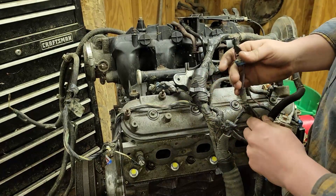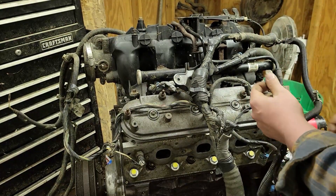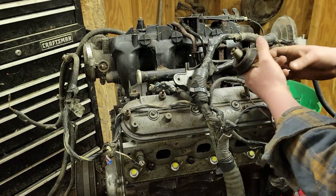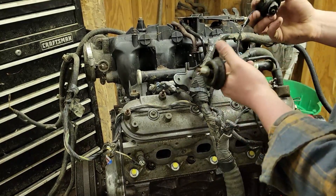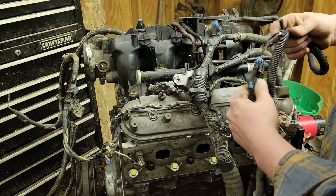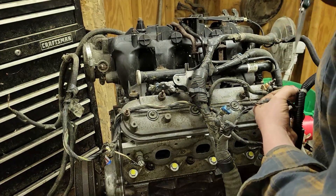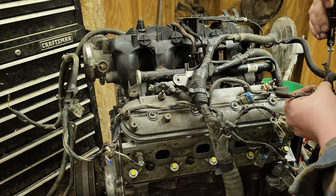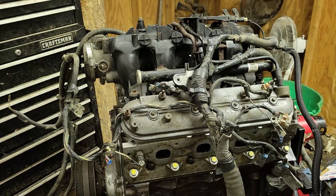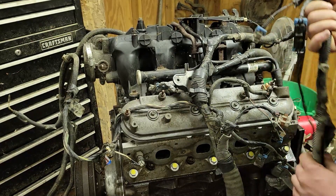We're going to start in here real simple. The previous owner had the AC bypassed - it didn't plug into anything on here, so we're going to roll with it. Right here is my little harness for my knock sensors. I do know I'm going to take this back off, put my knock sensors in, put the new harness in, but for right now this is just fine. I'll take out my pocket knife, cut this loom, and we'll pull this wire loom back.